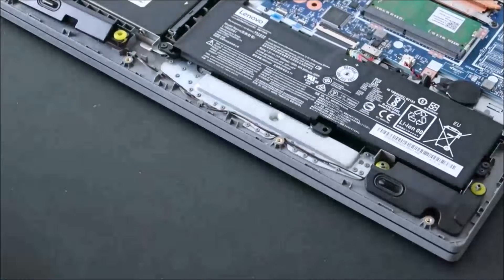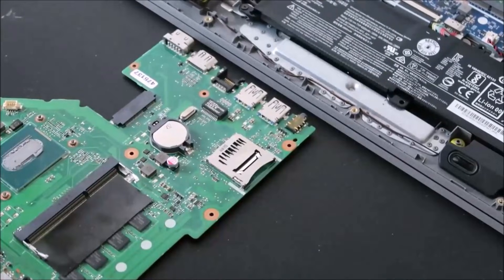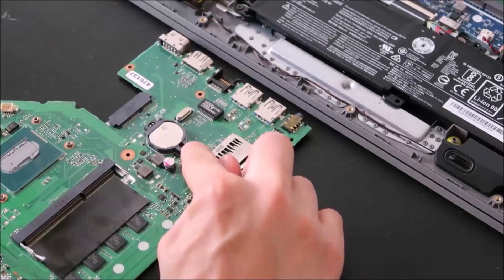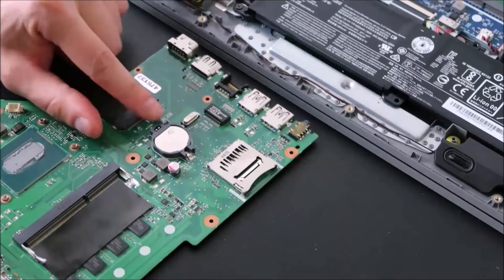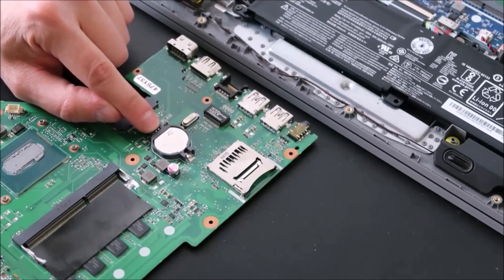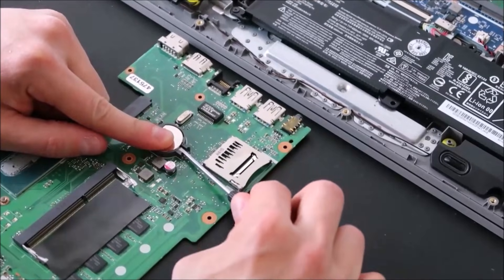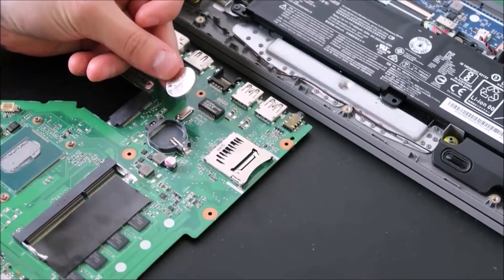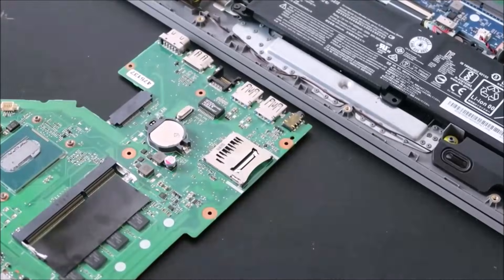If you have the other kind of CMOS battery — the coin-cell type seated in a holder — there's a spring that holds it in and a spring underneath that pushes it up. Push the battery back and up to release it. Be very careful because the plastic retaining clip is breakable; if it snaps off, your battery won't be secure. Push it in and up gently and it comes out. Leave it out for a time, then slide it back in and snap it back down into place.